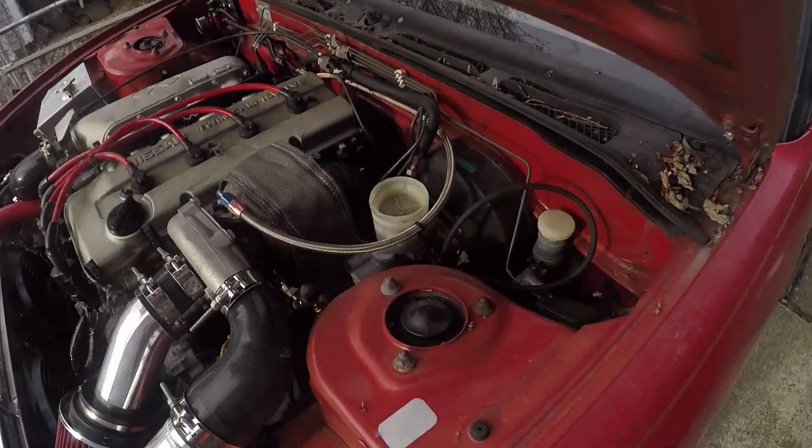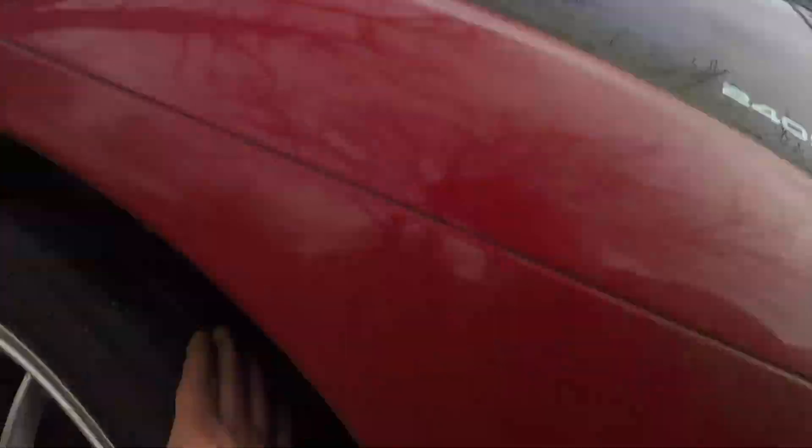As you can see, there's no fluid in there because the rear brake line leaks. Right at the passenger-side wheel where it switches over to the flexible line, it was corroded right there. It's also corroded where it runs across the body line underneath, right about here underneath my seat.